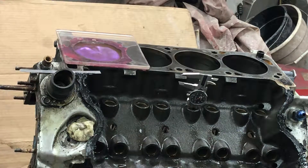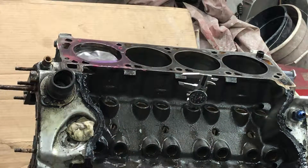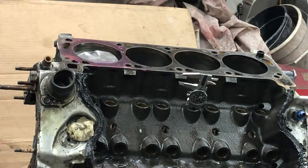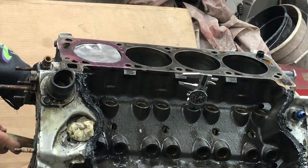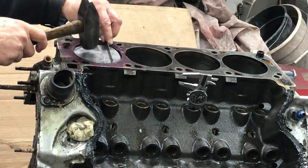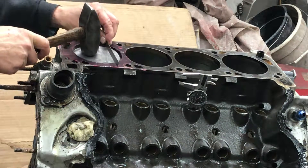Now what I'm going to do is take the plate off — this is going to make a mess, but I'm good at making messes. Take that off, push the piston up. There's no crankshaft in this engine so I just had the piston sticking in the cylinder here. Now I'm going to push it down flush with the top so I can put that plastic plate back on and cc this again.